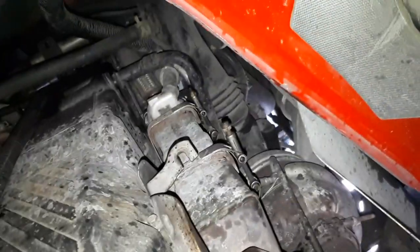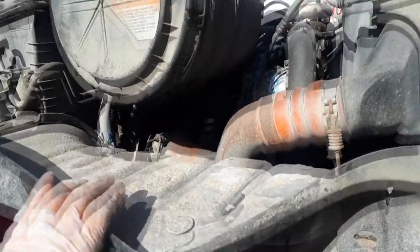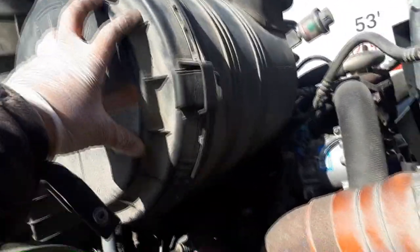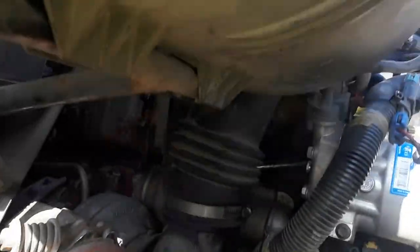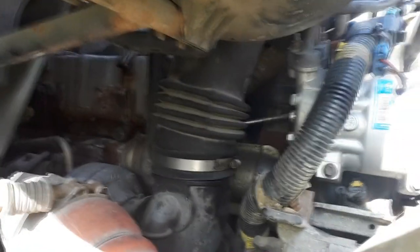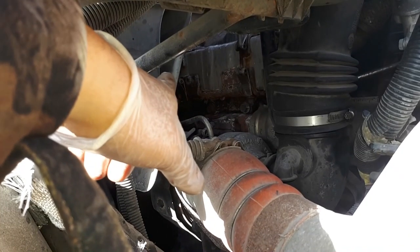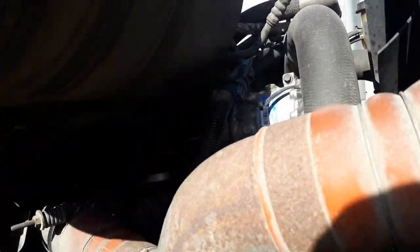There's another bolt back here — I guess that's where the coolant goes. These are already loose. I'm ready for the EGR coolers. First things first, we've got to remove the fender cover and the air filter housing. I've already pre-loosened a lot of the bolts for the EGR coolers. I removed the back engine cover to access the very rear. At the back of the cooler there are three bolts — those are really seized. It is quite a job. I'll probably be here for another six hours or so.